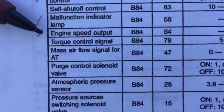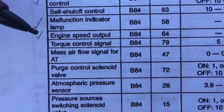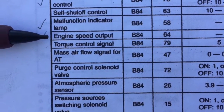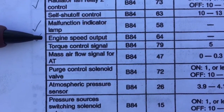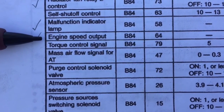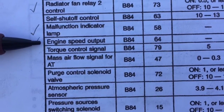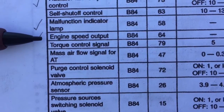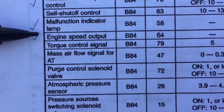Next is engine speed output — this is the RPM signal. You can connect this to a Vanagon's tachometer: on 1985 and below you can use the tachometer without modification, but on 1986 and up you need to modify the tachometer. There are sites that show how to do that modification, or you can add an aftermarket tachometer. I typically rely on OBD2 gauges for RPM.